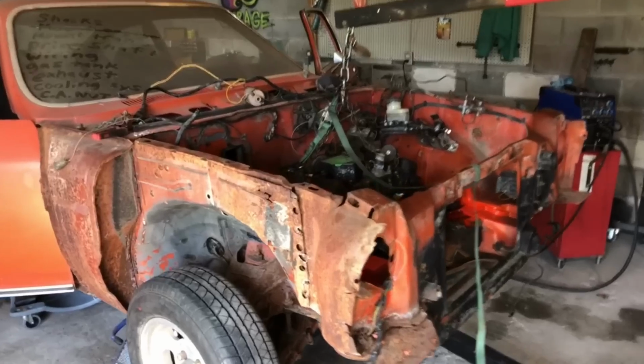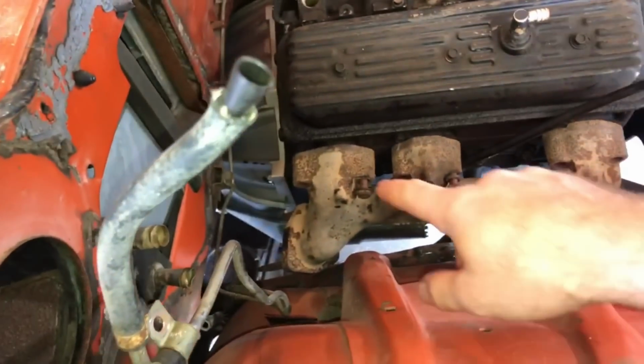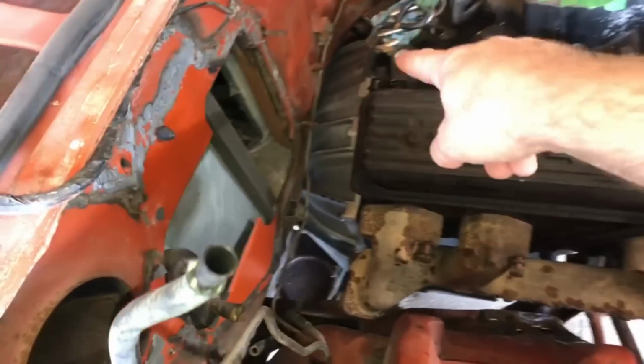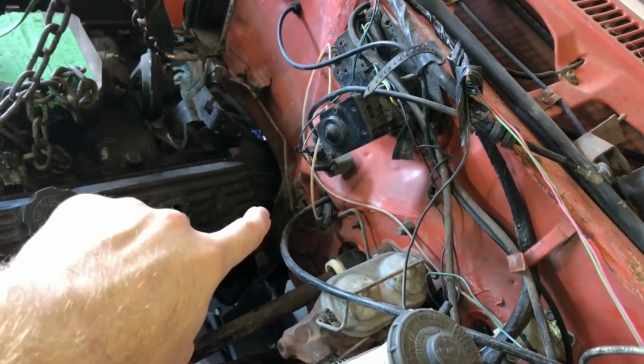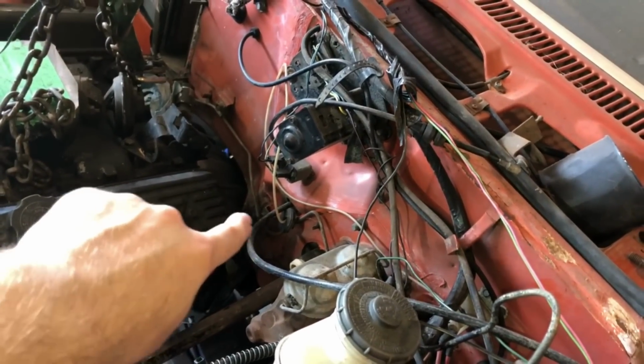It's actually relatively easy to push the pedal, which is what I was going for. Moving on. Engine's back in now, and everything fits reasonably well. This manifold here is probably what I'll end up running. We'll see. Bell housing clears pretty well, except right there, it's pretty close to it. So next time the engine's back out, I'll probably do a little bit more massaging right there.